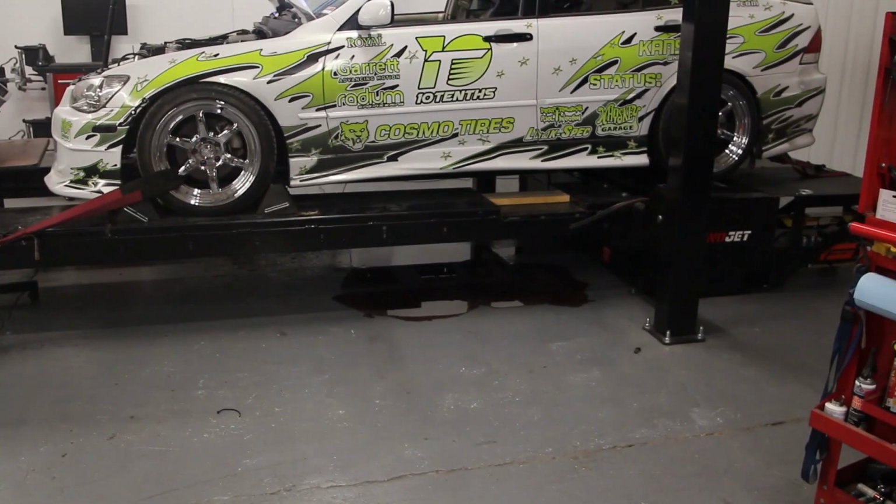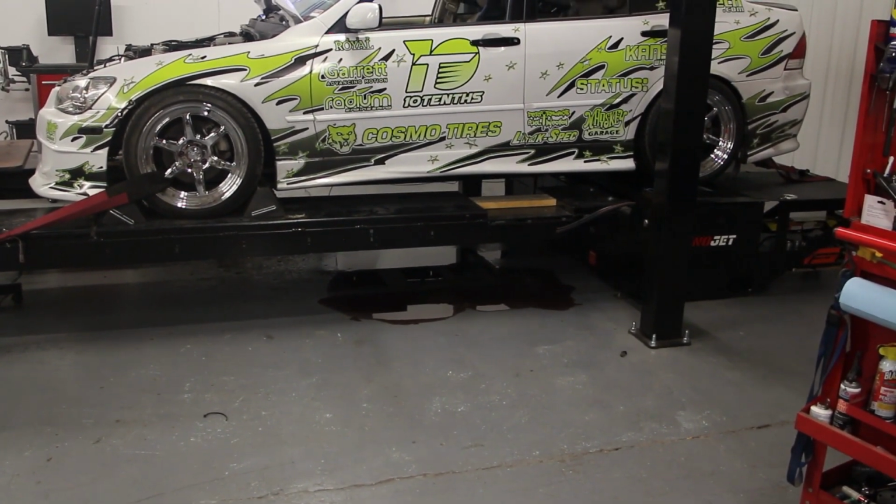And so now we don't have a bushing, but Dan has a spare trans, so it looks like the trans is probably going to be swapped out in order to prevent that from happening. The danger, if you don't change that out, is if the U-joint breaks or something happens and the drive shaft fails and hits the ground, it could take your legs off, or mess up the car or cause you to crash. So definitely something that needs to be addressed, but we were planning on leaving soon, and it looks like it's not going to be as soon as we thought.